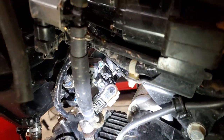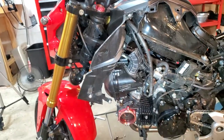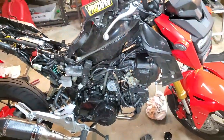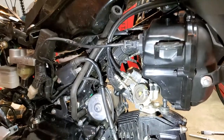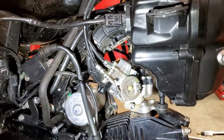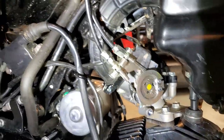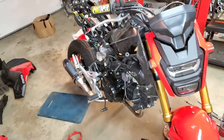It's a little black plastic screw, so be careful messing with it so that you don't strip it out. Those are the two main idle adjustments. Make sure you do these adjustments when the bike is fully warmed up, after you've ridden it around for a few miles — don't do them when it's cold because it will change once it warms up. You also have to take off all the bodywork to easily access all this stuff, otherwise you're fighting underneath panels. Just wanted to show that to everybody because there are tons of questions about it and people giving wrong information.